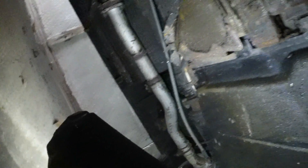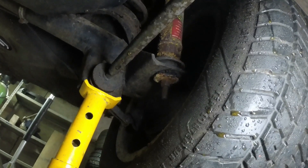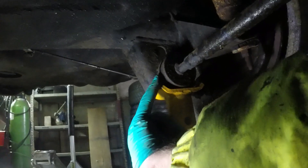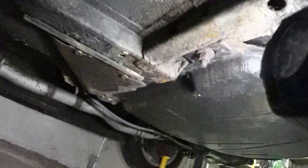In terms of getting the fuel tank out, we've got these two bolts here which I have to clean up and get some WD-40 on, and then there's a hanger at the back. It's got adjustable rear dampers which are very past it - I doubt that's adjustable any longer. The rear axle still has its trailing arm cups on which is nice - that cup usually rots out and disappears. The rear axle looks like it's been repainted; I don't know whether that's because it was swapped when it had the V8 conversion, because the rear diff ratio will have been different.